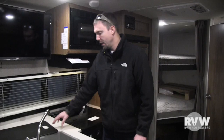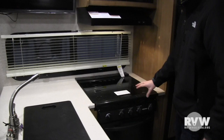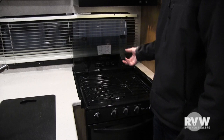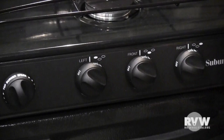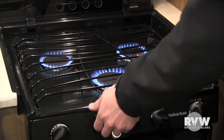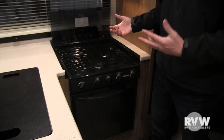You have a 50/50 double basin sink with a cover — a lot of people use the back side as a cutting board. Solid surface countertops. There's a glass cooktop — a lot of people fold it down for extra storage area; to use it, just fold it up and it locks in place. The first thing you want to do at a campsite is turn both propane bottles on, come to your stove, turn the burners on, and use the sparker to light them. Let those burn for about 15-20 seconds to purge all the air out of the lines — that way your furnace, water heater, and refrigerator will all function properly on gas. If you skip this, they may not fire and you'll wonder what's going on.